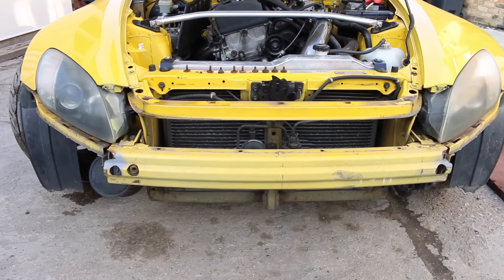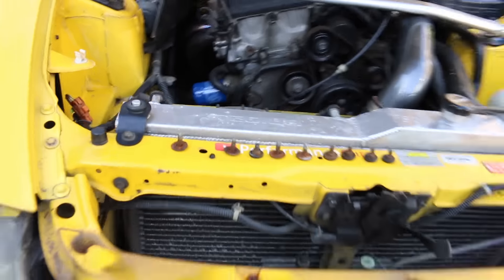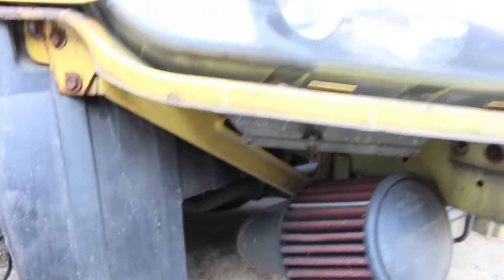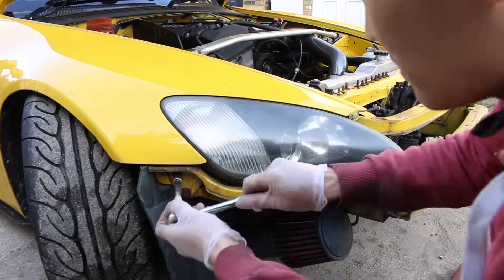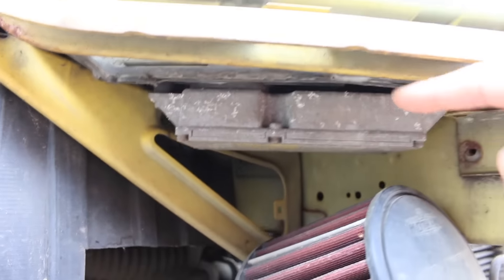The bumper is off — it wasn't too hard. The previous owner did use allen key style bolts and I'll be going back to the original Honda ones which I had spare. The headlights are quite easy to take off. There's a bolt down there, one down the side, and then there's one underneath as well. I'm going to have to take off this headlight support as well because the HID module is underneath here and it will be in the way.